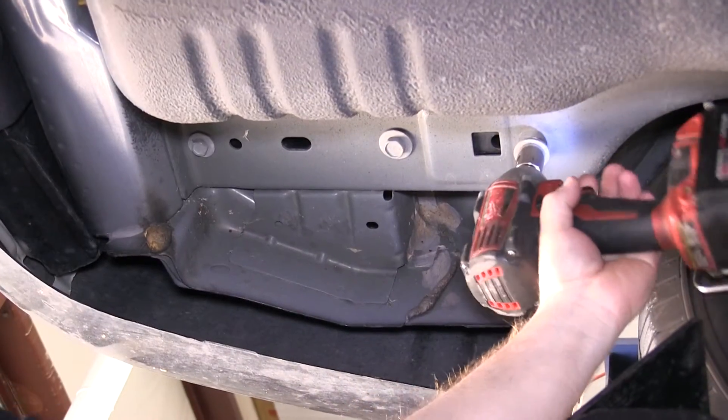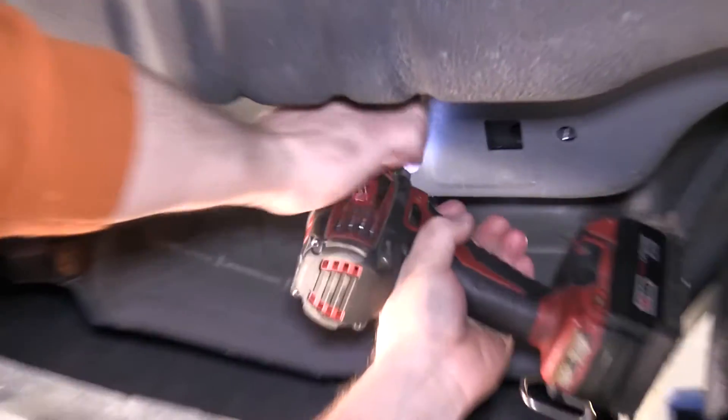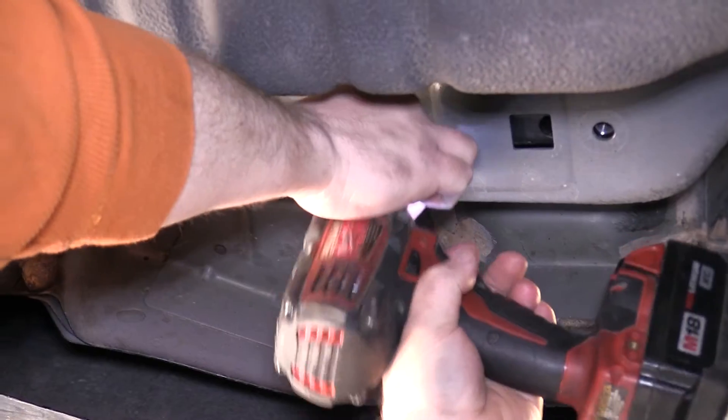On the driver's side, you will take out three of them. You may also want to be careful when removing the driver's side so that you do not allow the inner bracket to move around, which may cause you to have to realign them with the holes.